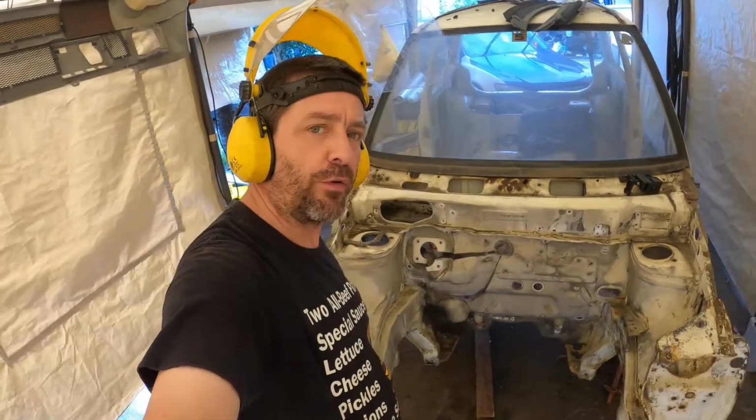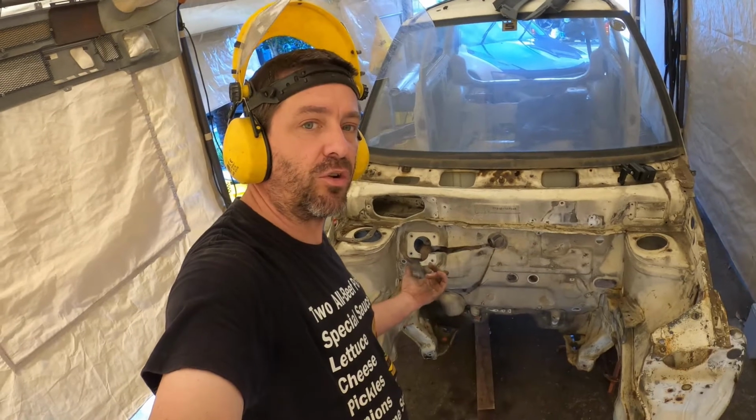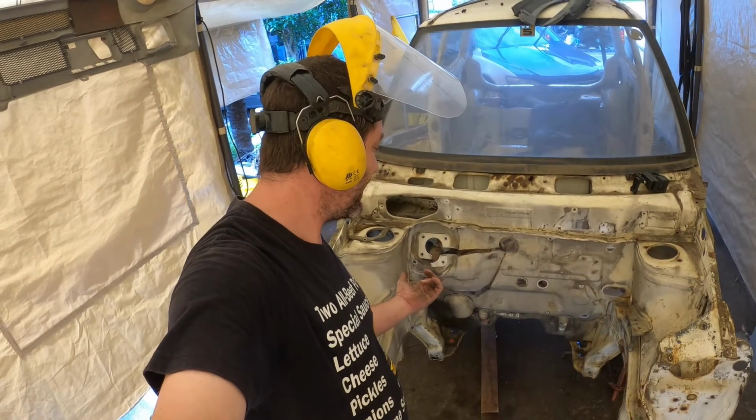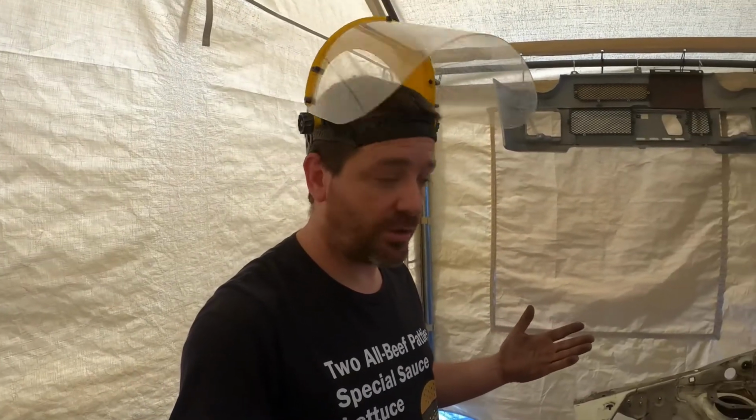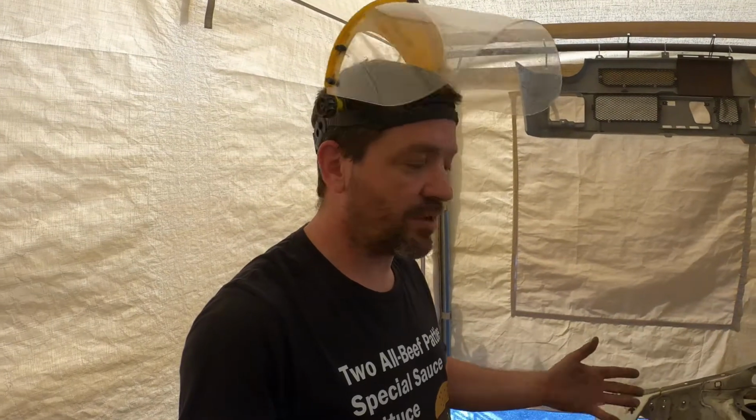But that worked pretty well. Now if I had some gloves on, I could grab it. Leave that there to cool down for a couple of hours, and then come back. Why did I cut the area so big? Well, I can't weld it right away because I don't have the paint yet. I can't decide what kind of paint I should paint this with to protect it from rust. So I decided that I'd cut it larger than it needs to be so that if the edges rust, that's not going to be a problem because I'll be cutting this to a smaller size.